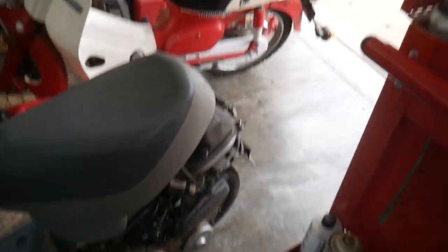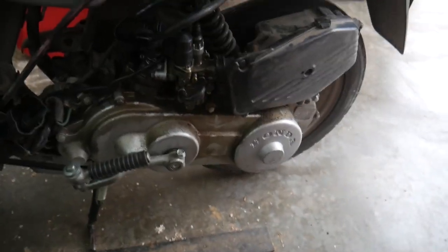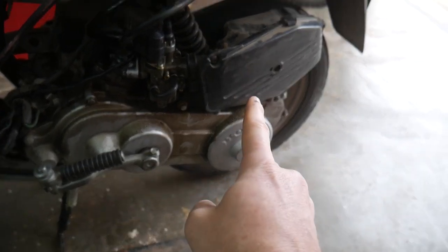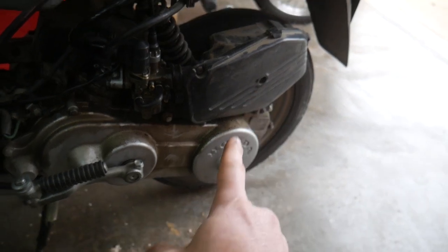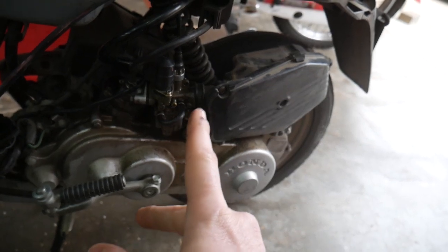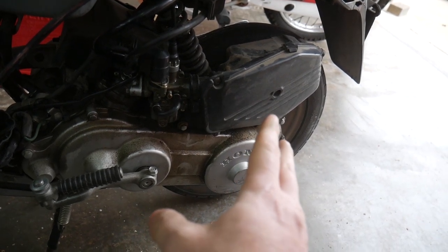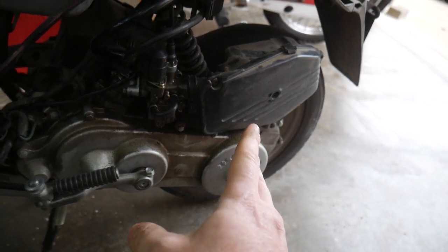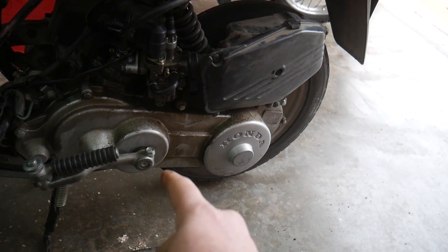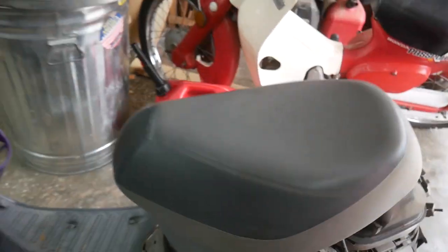Well, maybe you guys caught it before I did, but with these little two-stroke engines, the amount of air that's brought in is definitely important, and since I had the air cover off, it was letting in too much air, and that's what was killing it. As you saw with the footage right before this, everything's running good. I used a GPS speedometer because I don't have a working speedometer on this yet, and it registered around 30 miles an hour, which is probably all I can expect out of this little guy.